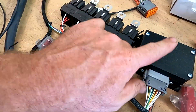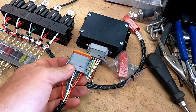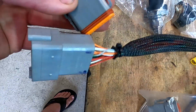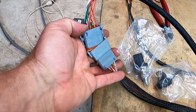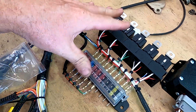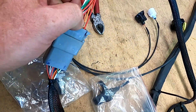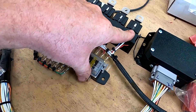Instead of relays and fuses in this box, we don't plug the ECU into that factory box — that isn't going to work. The plug will plug in but you'll blow it up, so we don't do that. This one plugs into this plug. We've built pretty much a standard set of relays and fuses, but in the case of the Haltech running the auto, I've added a couple of extra wires for the start inhibit switch. The start inhibit switch is taken care of with these relays.